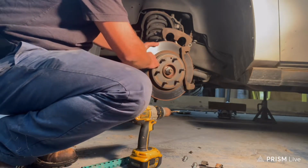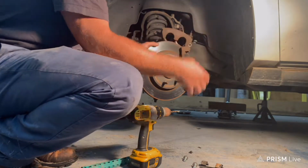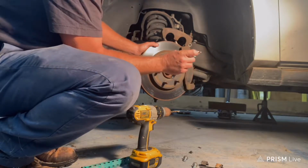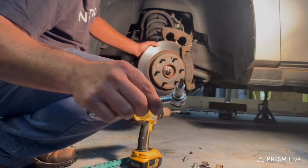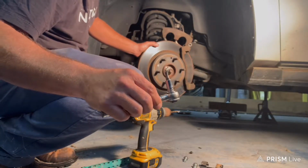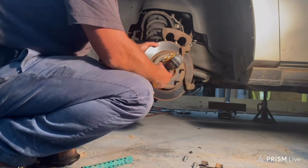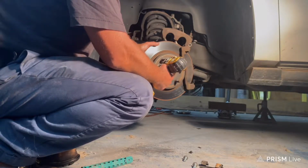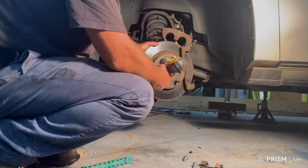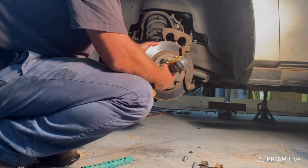These screws that they use to hold the rotors on, they're T30, which are these little star bits, and they don't work real great, and they tend to strip out. So what you got to do is drill it out. These aren't really important because you don't need them. So we're gonna drill them out and not use them because they're not necessary. They're just used for holding the rotors on the assembly line, basically. So they don't have to be put back in.